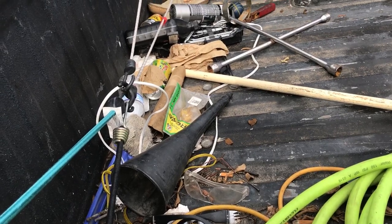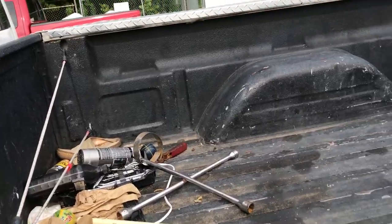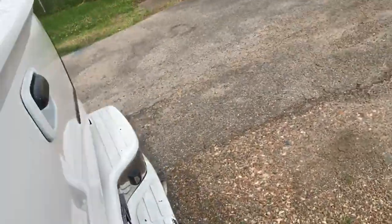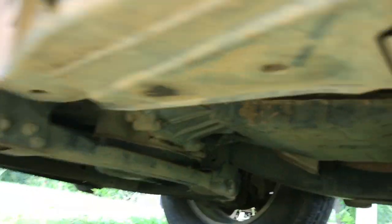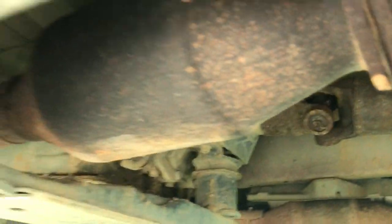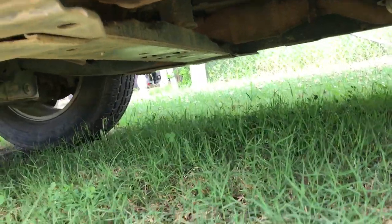When I get some more money I'm gonna go down there and take it back to the shop. Another problem just came across my mind - I'm gonna show y'all this problem. I think it's these secondary cats on my dad's truck. I think they're clogged. I hope it's not the first ones because they're by the manifold and I can't do anything about that. But the secondary cats are fine to cut off. I'm gonna go try and take the trash off in this truck.